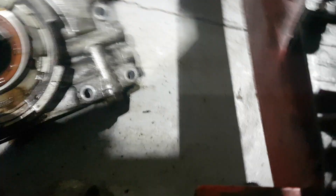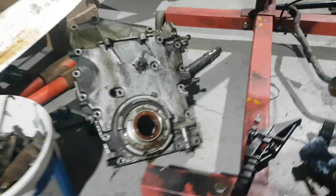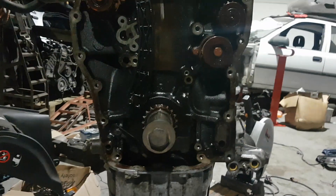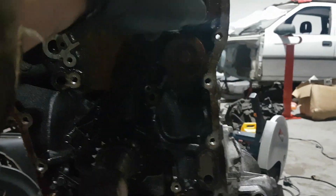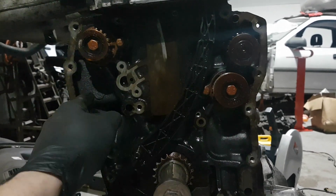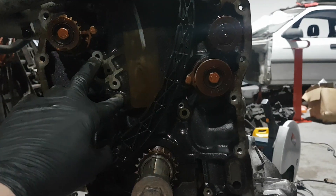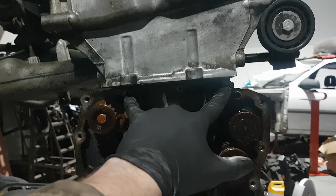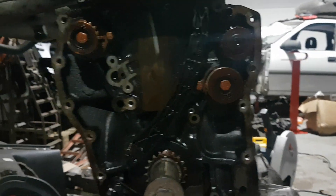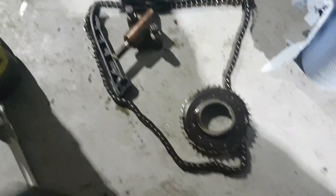You'll find your balance chain comes around there. There are tensioners here, another arm here, going around there. Two 10mm bolts here and two 10mm across the top which takes the guide off the balance chain. Once you get this off, the balance chain should slacken enough to pull the chain off. That's basically how it is.